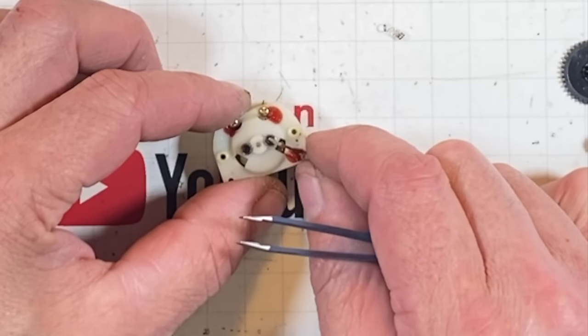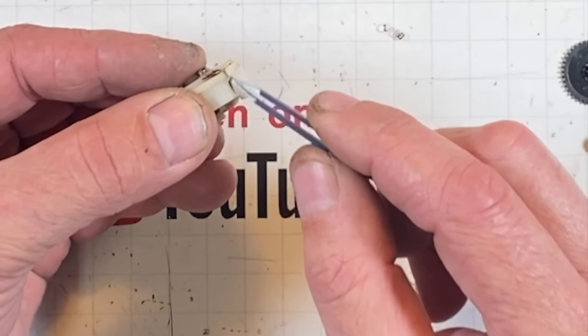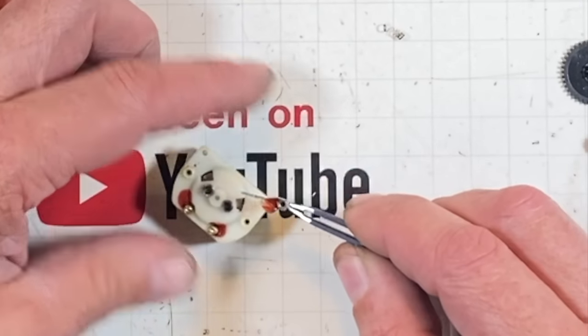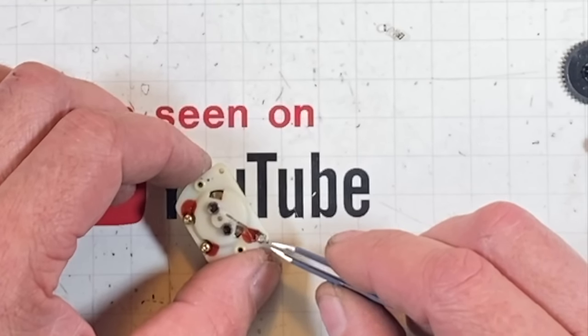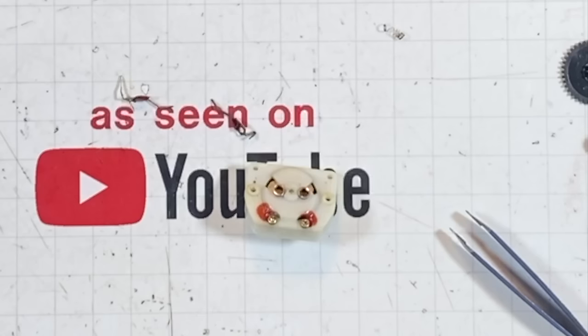Now these guys, they come up from the bottom. And of course I took them off and I didn't pay much attention. This is the pickup which gets it from one side of the frame or the other side of the frame. And these can go on either way. If I put these on backwards, it's going to cause the motor to run backwards in what would normally be the forward position. Let me see if I got some footage of that, because it's pretty important.